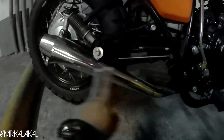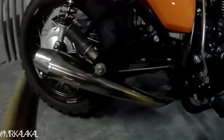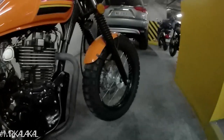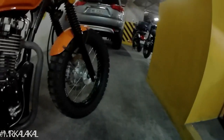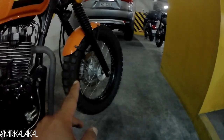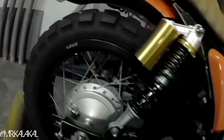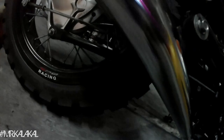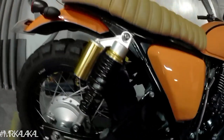I'll be replacing the BR bullet pipe too because according to some riders, it's not a great match for the Cafe 400. So we'll change that after quarantine when we can go out. For the wheels — tires and rims — I'm using SPD rims, 18-inch front, spec is 2.15 by 18. I'm using 805 tires, size 120 by 90 by 18. For the rear, SPD rims again, 4.25 by 17, and the tire size is 150/70/17.